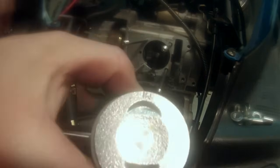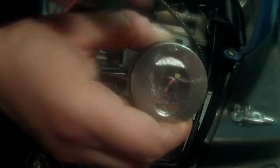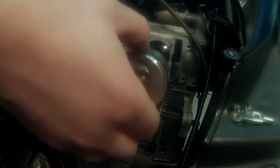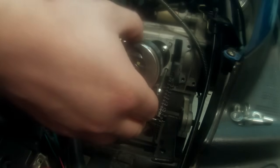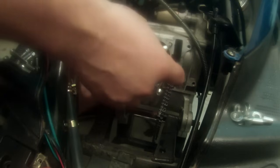All right, at this point, we're gonna go ahead and put our piston on. So what we're gonna do, and this is probably the most challenging part of the whole build, but it's not terrible. So again, I have my piston where it says IN. Hopefully the light's not too bad, but that says IN right there, in for intake, so we want to make sure that's facing up. And we're going to slide down the middle of these studs. And I'm going to try to get it on this connecting rod here.